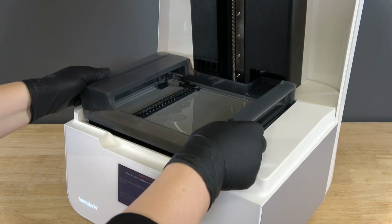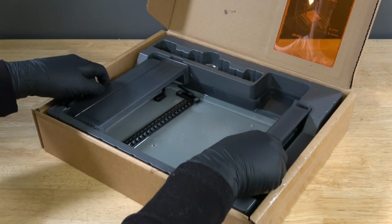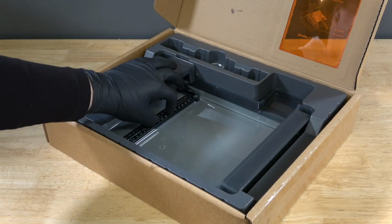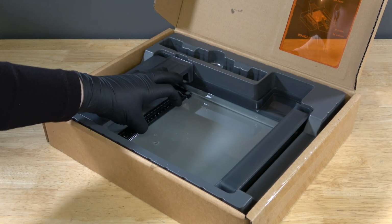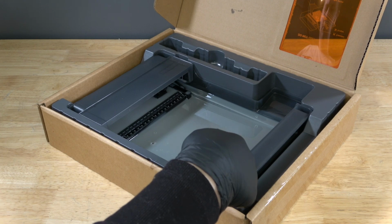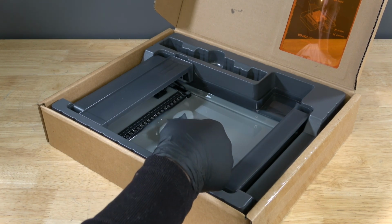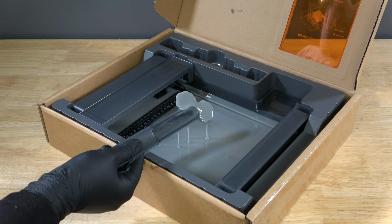This is the design behavior of the mixer and is intended to protect the tank film and prevent further print failures. When this happens, use the tank tool to inspect the resin tank film for cured resin or other debris. Check out our video for removing debris from the resin tank to ensure that there are no obstructions present. This is the most common solution to mixer check failures.